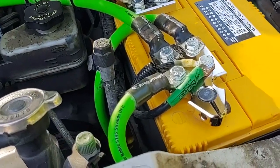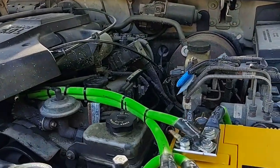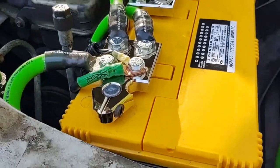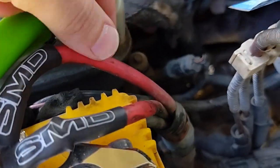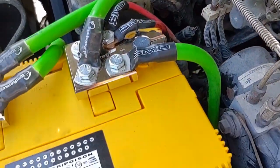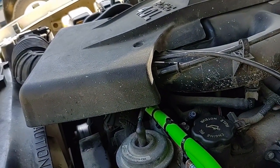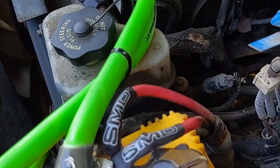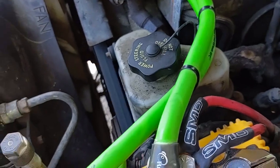On to the real question: do you need it, and if so, what do you need? That basically falls into two categories: high output alternator or factory alternator. High output alternator — absolute yes, you've installed a high output power source, you need high current cable. Factory alternator, you can bend the rules a little bit. The factory wiring is going to be ample to handle everything the alternator can produce, but it's designed to do that for short periods of time such as top-charging the battery on startup. So when you start bumping your system, running the alternator at sixty percent capacity for forty-five minutes, it can heat up that little charge lead. This is when you want to add an additional charge lead to disperse the load between the two wires. Even an additional four-gauge lead is plenty for a factory alternator.